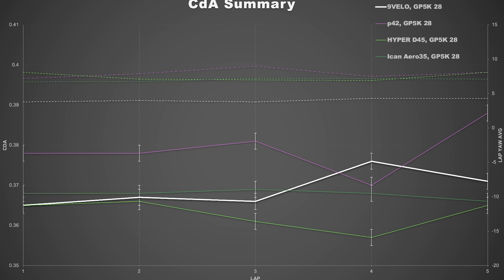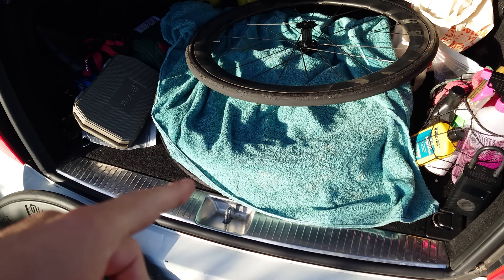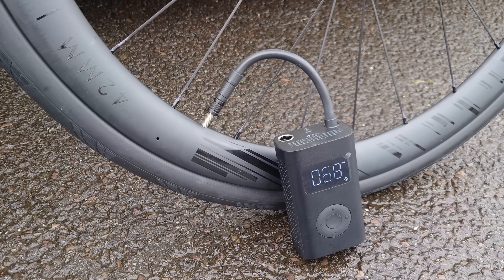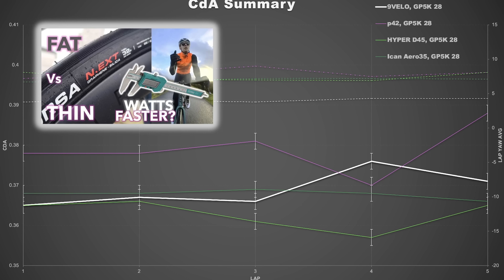The last comparison is with the Ascent Polaris 42mm wheels, which were built on DT 240 hubs. We found the non-drive side on the rear of those had quite low tension even though the drive side was nominally good. They are so wide out to the disc side that spoke tensions remain quite low. On the Nine Velo, the non-drive side — the disc side — is much, much better. The drive-side tensions are more or less the same as the DT 240, so I'd actually say this hub has better geometry than the DT 240.